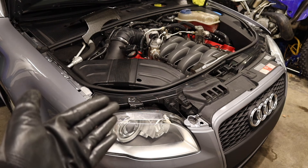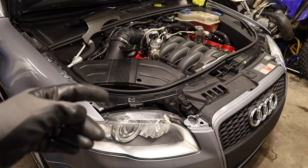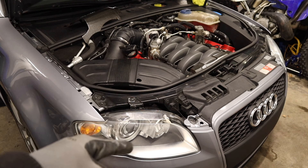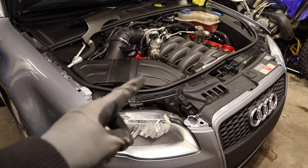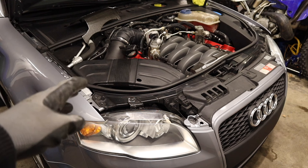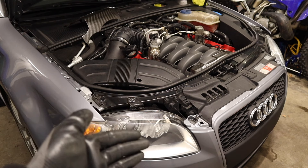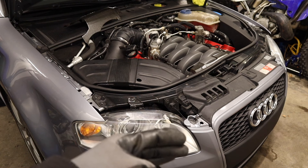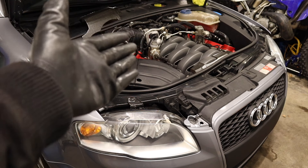For even more novices, using that alternator rotating method with the belt gives you even more space in service position. Service position can help for carbon cleans for novices, but you better be ready to turn it from the alternator and be confident your belt will move, or get the tool and go right on the motor. I highly advise getting your skills mastered on Japanese cars or lesser Audis, Mercs, and BMWs before doing this, because service position allows more sloppiness to occur if you're not careful.